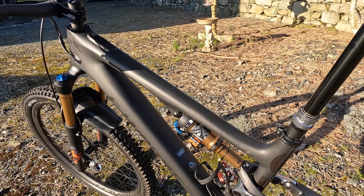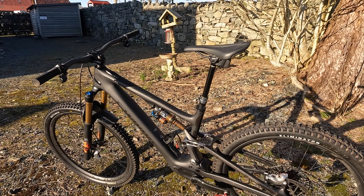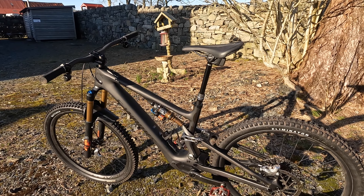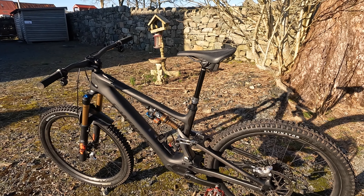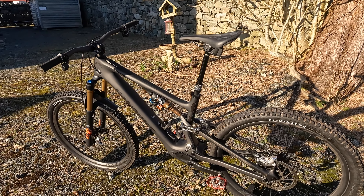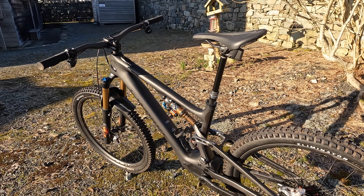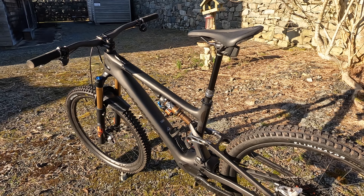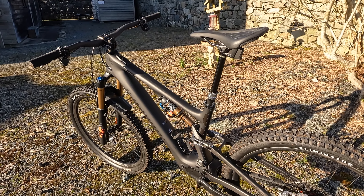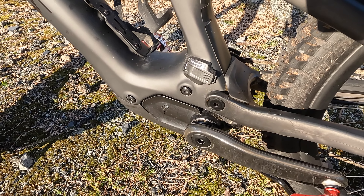The really clever thing is that despite a much chunkier build — more travel, piggyback shocks, bigger forks, a more powerful motor — the overall frame weight is pretty much exactly the same as it was. This S-Works in a size 4 weighs in at 17.6 kilos without pedals, so pretty light. Not as light as the Scott or the Pivot, which in top models go down to about 15.5kg, but still a very handy and agile e-bike on the trail.